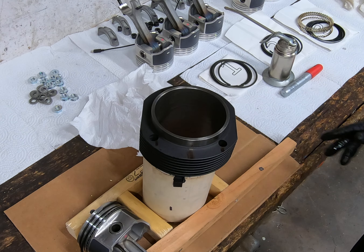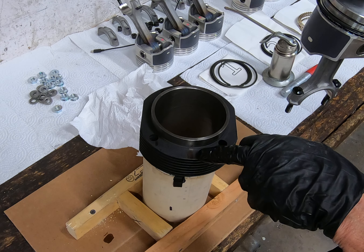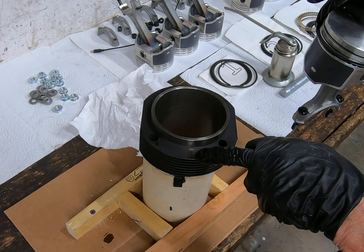We're nice and tight. Now I'm going to take the piston — I have already marked the top of the cylinder. I'm going to find the number on the rod, number four, and I'm going to insert it gently down into the hole.